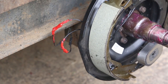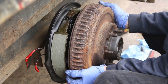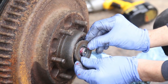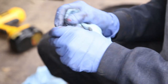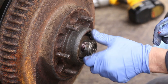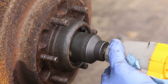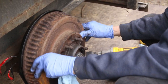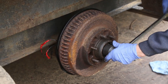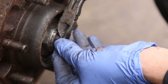You could also use regular electrical tape, but I prefer liquid electrical tape — it's a little cleaner and easier to use. Once it dries it's waterproof. Now just fit it, thread it through the holes, put the washer in and it'll pop right in. Put the big nut on, thread it carefully by hand first, then use an impact wrench to tighten it, and torque it properly. Make sure it rotates properly in the axle, then tighten by hand and use a torque wrench to tighten it to the proper amount.